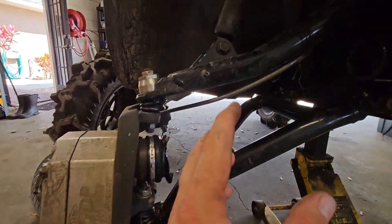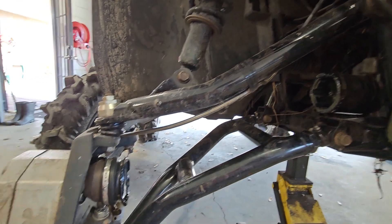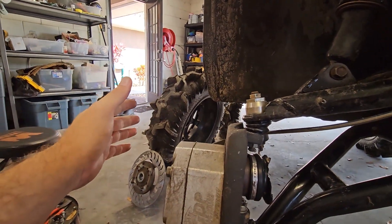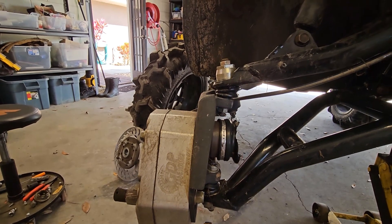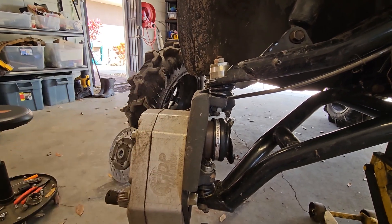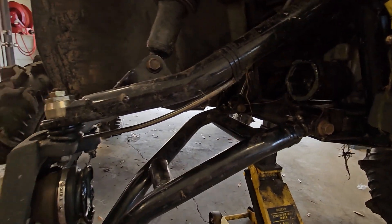How did I break an axle at the portal? The engine is still capable of outputting the same amount of torque as a factory machine. If you get in thick enough mud where the tire comes to a complete stop almost, the portal's not helping you at that point. Because this is locked, your engine's putting out the same torque — same as having your tires completely locked without portals. And if you have the wheel turned pretty hard in reverse, you can still break an axle. I proved that here.